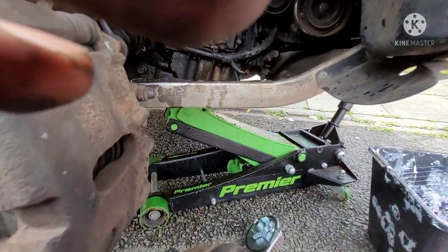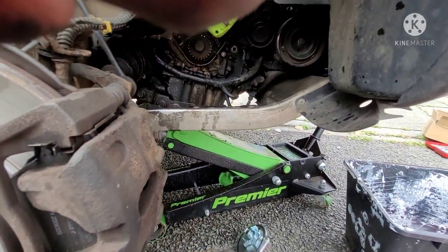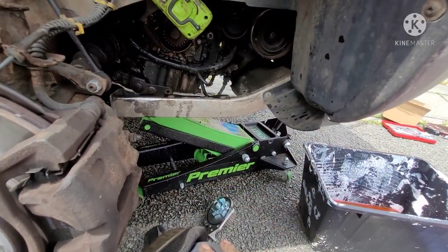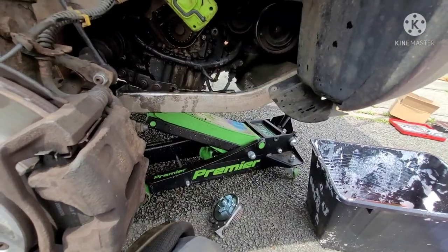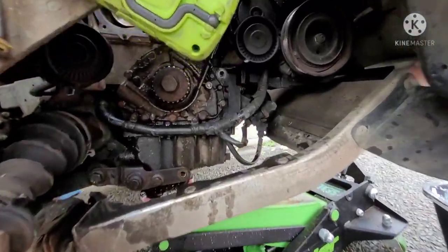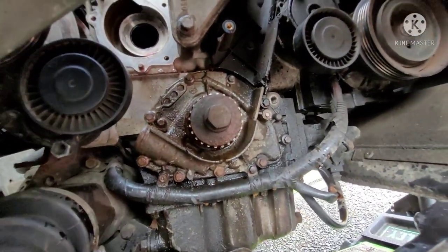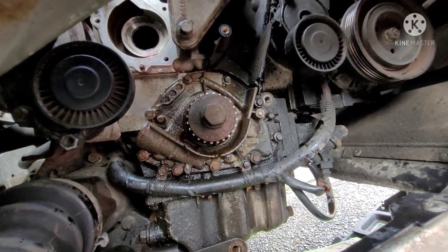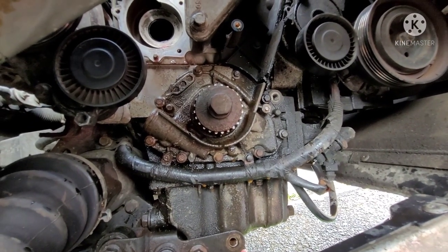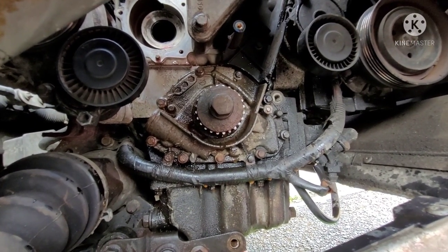Then put the new water pump in and tighten it up, working around in a circle to make sure it's all seated nice and torqued up and snug down well. Once you get that, we'll clean up in here a little bit and try to dry off some of this real quickly so that the belt doesn't get wet. And then we'll start doing the belt.